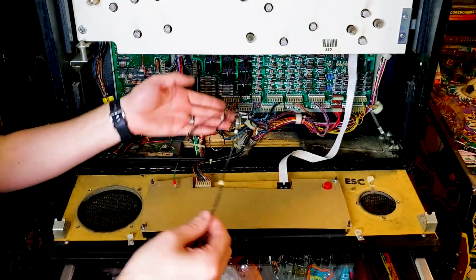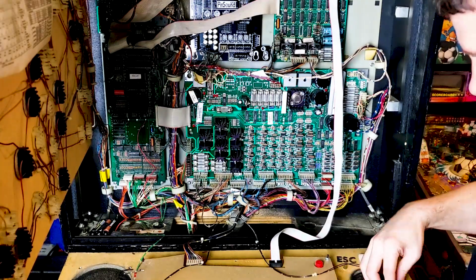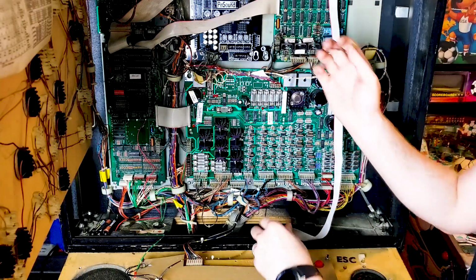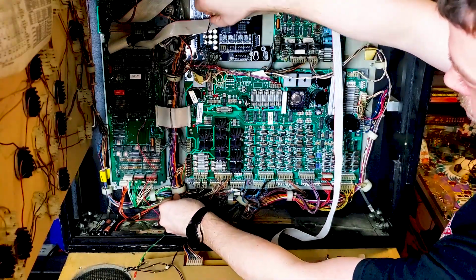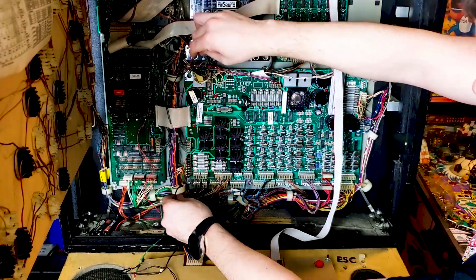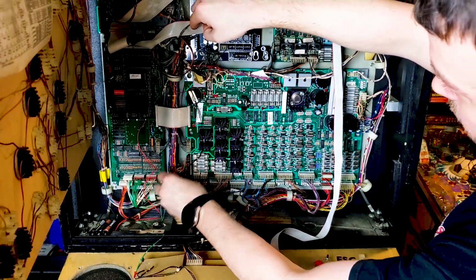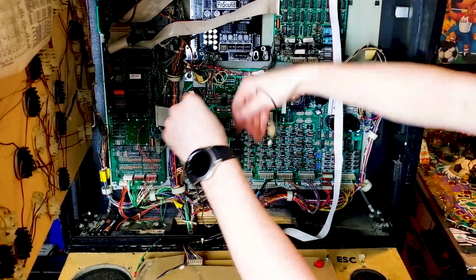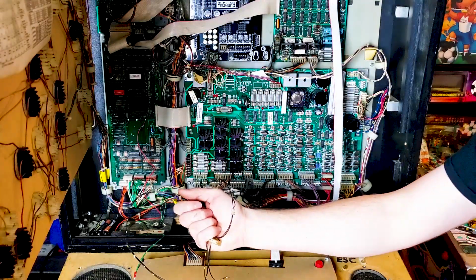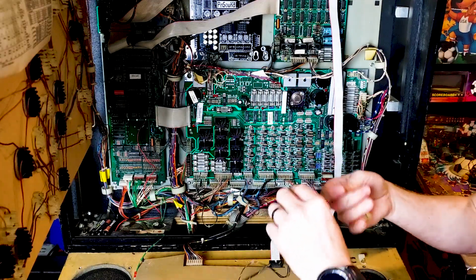Alright, now let's get this cable completely removed here. Alright, so I've got the original speaker cable removed. I didn't want to record that because it took a little bit of time to finagle this cable through all of this mess right here from this board. But that's where it goes, is from your speakers all the way up through this stuff, around and up here. You can get that. Now you no longer have these extra cables on your back panel, and you could store these somewhere. Make sure you label them so that way you know what they are.